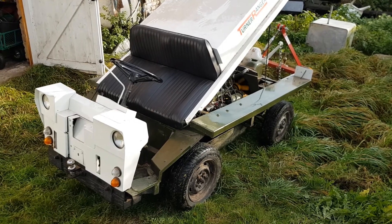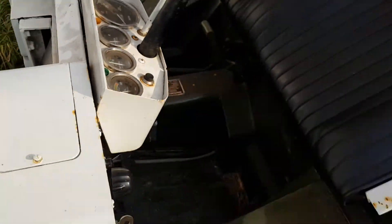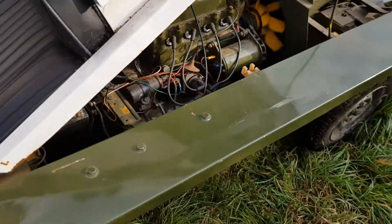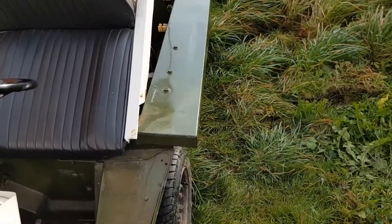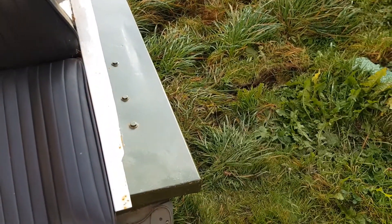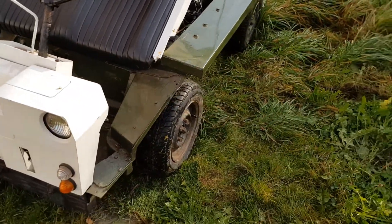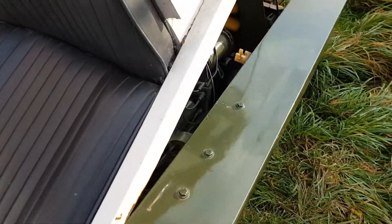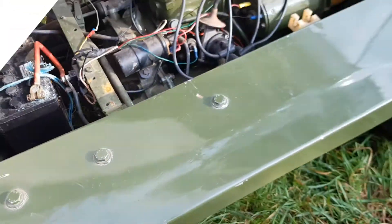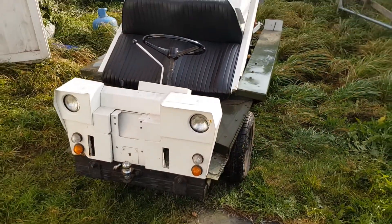I've come back to this in daylight and given it a good run. The engine is fairly warm now, though it's quite a cold day. I've done a few tweaks on the vernier to get the timing about right, and I've also tweaked the mixture a bit because I think she was running a bit too rich. It seems to be idling okay. Still a little poppy on the exhaust, but as I say it's only got half an exhaust — just one can. If I turn it off for a second you can see the exhaust just comes straight out there. Let's see if she restarts — yep! I think we'll call that a win.